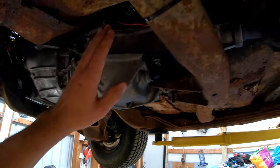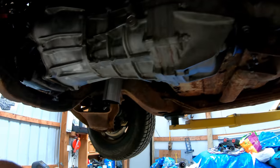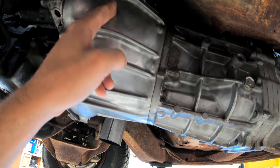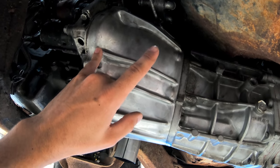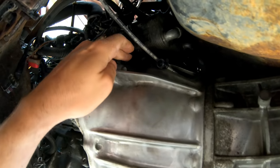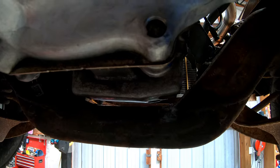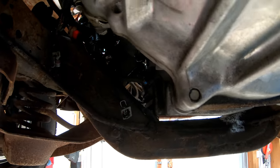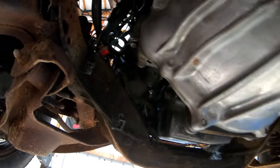But we're going through a 2005, 200,000 mile, junkyard, $100 transmission. Inside the transmission, we've got the Solstice throwout bearing, Solstice pilot bearing, going to Solstice clutch with Cobalt SS flywheel, Cobalt SS pressure plate. We had to do a little bit of clearancing on the bell housing up there. Just grind down one of the bolts near where the oil cooler bolts on. When you make the motor mounts, I put bolts underneath the motor to space it so that we've got ample room there, so we're not bouncing in. There's some wires that we just tucked in there, but there's an air gap.